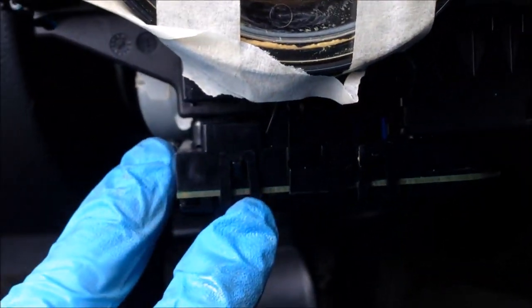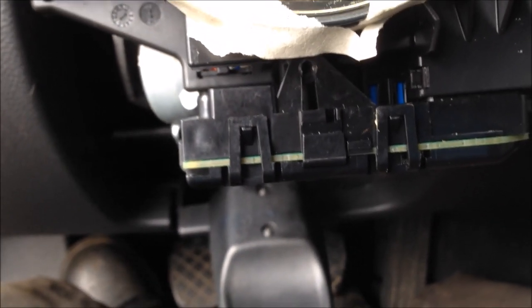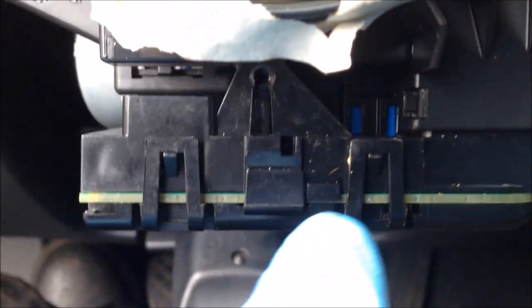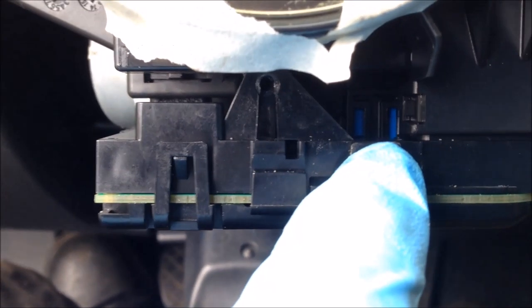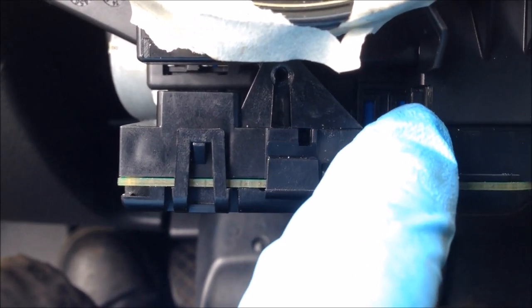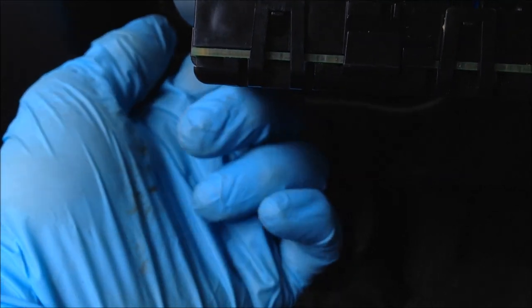There's also this whole module right here. This piece is actually held on by two snap clips. There's one snap clip located right in this blue area down in there. So I'm going to use a steel rule to push that. And there's another snap clip located on the back side — you have to push it from the back side.